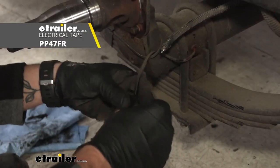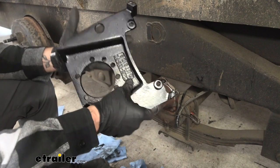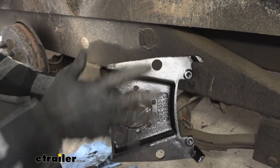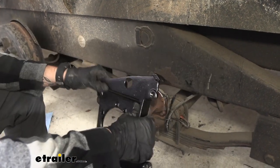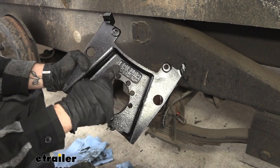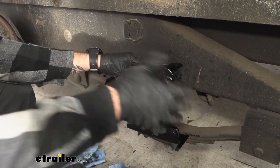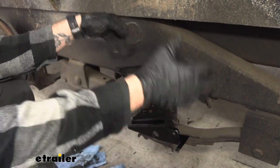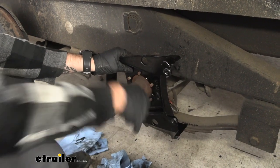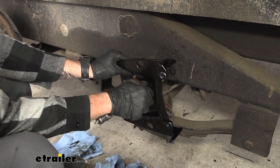Next, we're going to go ahead and put on our mounting bracket for our brake caliper. We're going to want to make sure that we have it facing this way — it's going to force the brake caliper away from the trailer frame to give us enough space. If you look at this side, you'll have the model number for that specific part. There are a bunch of different holes on here so you can adjust it as needed. If you have issues with space and can't get the caliper on because of the frame being in the way, you can adjust that around. I'm going to do it so that our calipers are facing towards the rear of our trailer, and then I'll tighten them down with a wrench and torque them.